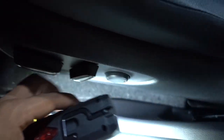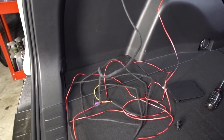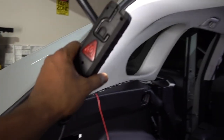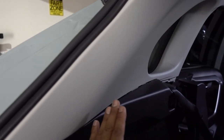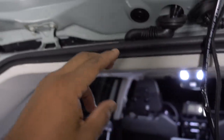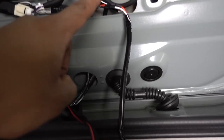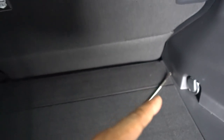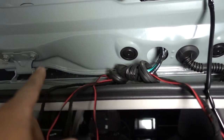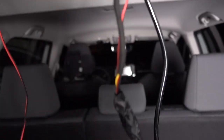On this cover right here on the B-pillar, just lift them up a little bit so we can put the cables through. Same thing in here on the back side — you can put zip ties and get them tied to the wire harness that goes through to make everything look clean. Put them all the way through and bring the cables right here, then put them all the way up through that grommet and bring them to the box and connect them. The cables go right here and around this part, going up all the way inside. Since that grommet was full, we changed plans — we used a piece of metal with electrical tape on one end, fed it all the way in, attached the cables to it, and pulled it through. It was kind of hard and takes a lot of time, doing it little by little, but all the cables are through.